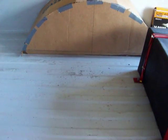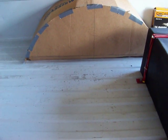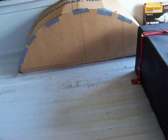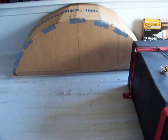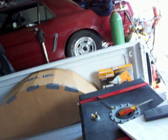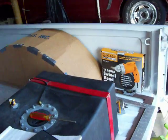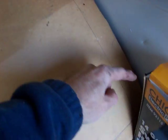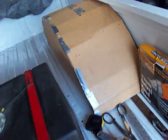The lips on the bottom will be folded in and then there will be some sealer, and I'm going to probably pop rivet it — that's how that's going to hook on. On the back side, you can see where I drew a line — this is going to get V-notched along here, those will fold in, and I'll put a couple pop rivets on the inside. Again, seam sealer along it — it'll all be nice and water tight.